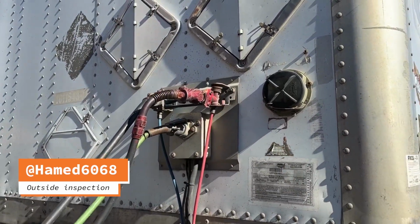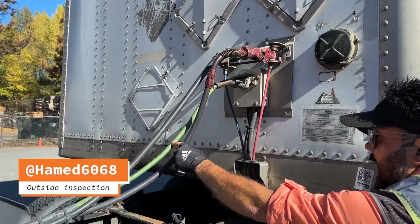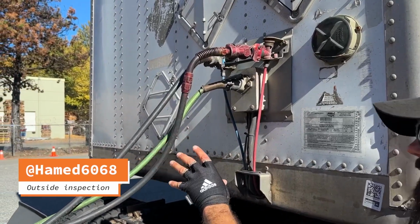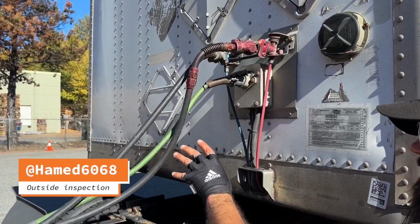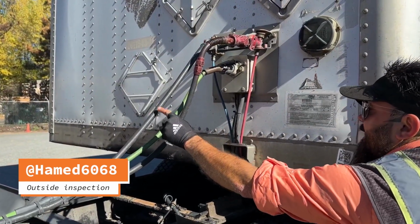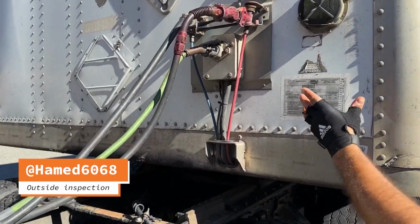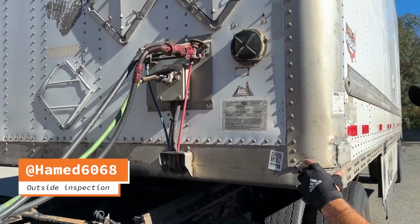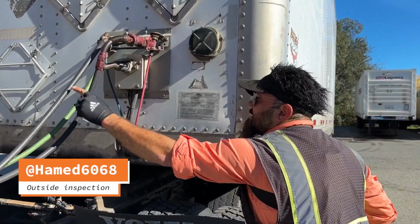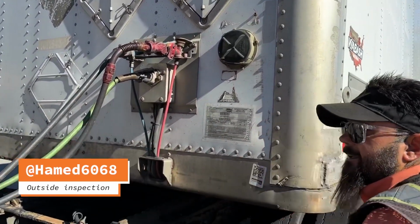into place. Air hoses and electrical lines are not cut, chafed, spliced, taped, worn. Air hoses and electrical lines are not tangled, crimped, pinched, or dragging against tractor parts. Air hoses and fittings are not leaking.